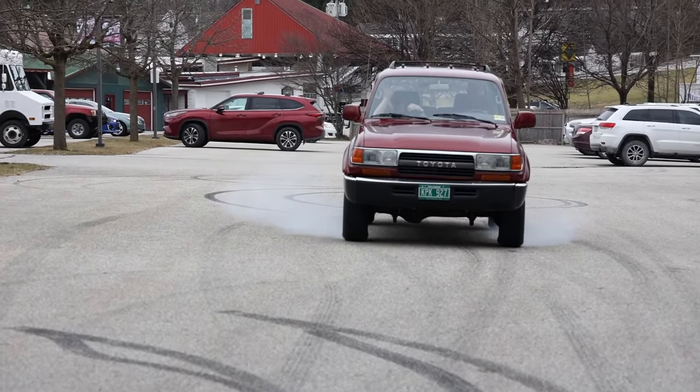Oh, God. All right, so it locked the front brakes like it's supposed to. Totally locked them right up, yeah. So the idea behind that proportioning valve is to keep the rears from locking in a panic stop, because that will swing the back of the car around. Gotcha. And you want to protect people from having the back of the car swing around. That is. So it's going to understeer and it's going to go to the front brake bias as a safety measure. What you would like is a little more rear bias. I would like a little more rear bias. Because then you got all four locked up, and that's more braking. But probably drives better than your average Joe in that instance.